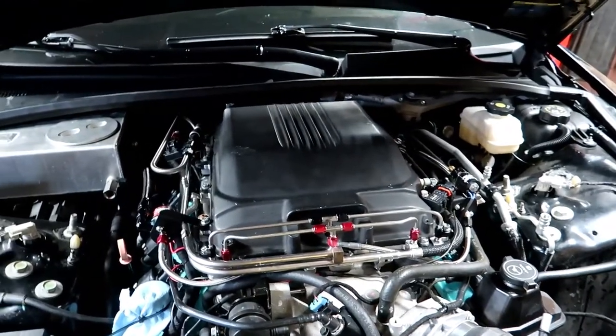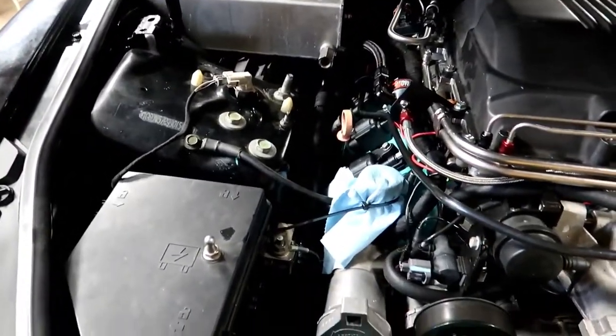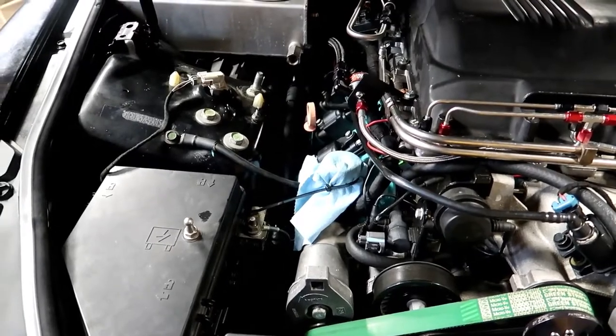So there is the engine bay. I don't have the strut tower brace in right now. Main thing I'm waiting on is - as you can see - I'm going to be running a Mighty Mouse Wild oil catch can. I was working on trying to modify a K-motors unit that came on the car, making it kind of like the same style as the Mighty Mouse where it ventilates if it has pressure. But I found that the fitting had a big fat outer but the threads were small, so it had no flow - when you blew into it you could feel the restriction. Not what I want.